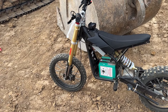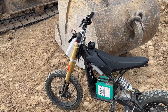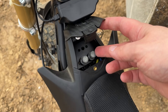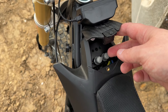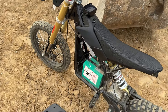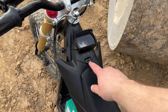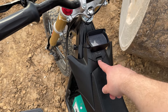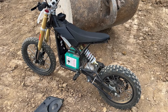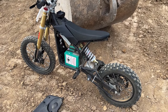The recommendation if you get your kids one of these: definitely upgrade to the hydraulic brakes. The newer models come with those standard now, but I would definitely upgrade from the mechanical. This also has a throttle response and max speed dial that you can twist to set the top speed. If you have a younger kid you can set that down and keep it locked so the kid can't open it — you can add a screw with a special head so they can't access it. Say you have an eight year old and you want them to only go 10 miles an hour — you can set it to that and it won't go any faster.